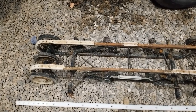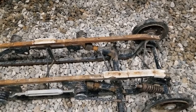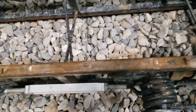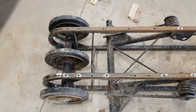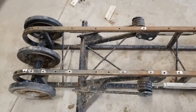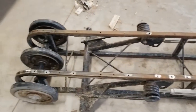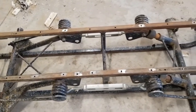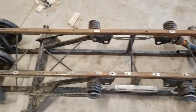That existing Hyfax crumbled away bad. That first ride we took was just a quick little loop — me and the kids — and it just got super brittle and broke off. As far as did we do any damage on that little ride? I don't think so. I don't really see anywhere on that skid — we just got some old rivets to either drill or grind off. Here's the skid after getting all the rivets out. Some of the Hyfax pieces had broken off and the track rounded off and ground down some of the rivets. I used a drill bit for most of them, a cut-off wheel for some others, and a center punch and drill bit for the rest — 3/16ths is the hole in the skid. I scuffed it with Scotch-Brite and we're ready to put the Hyfax on.